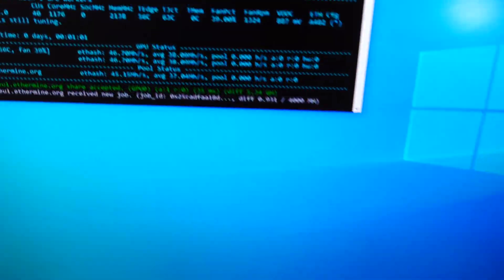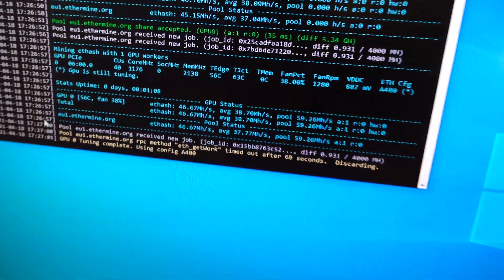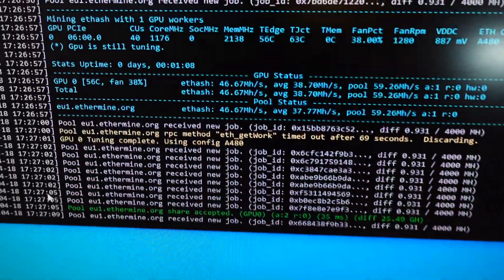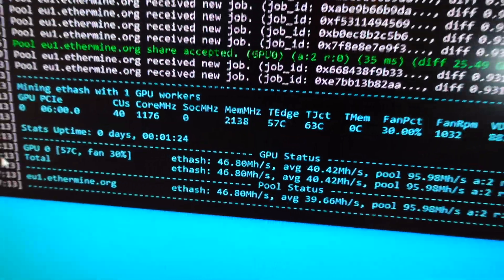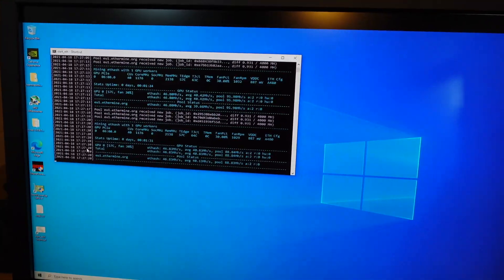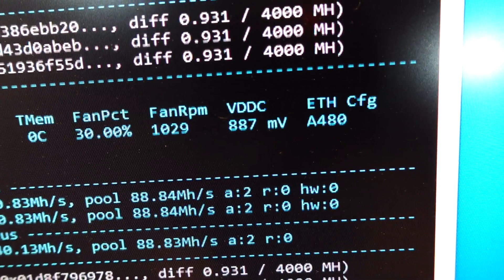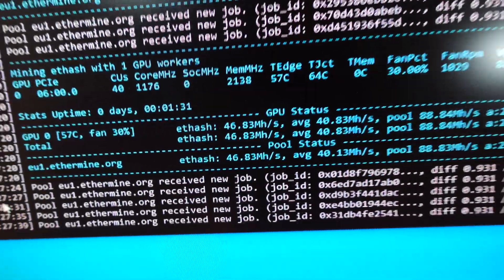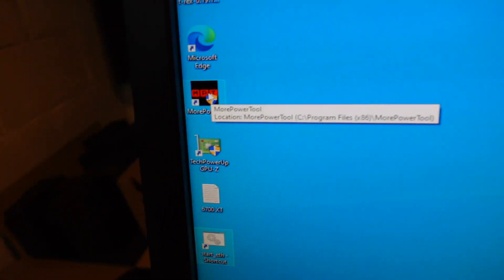Because again, about 30 watts is just for the test bench — my motherboard, CPU, all that. So 46.7 — we lost just a little bit, we might even still get back up to 47 if we let this roll for a little while. 46.8, still going up. What we're going to do now is a little bit of work to get that voltage down even further. You can see we're at 887 millivolts on VDDC. If we can get that lower, we can drop the wattage being pulled from the wall while making sure we're not losing enough hash rate. So we'll hit Q to quit the miner.